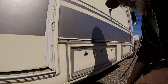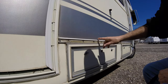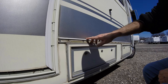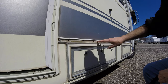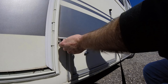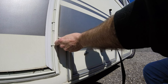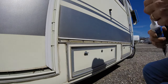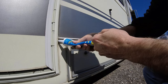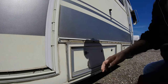The idea of this stuff is to cover these screw heads here that hold this rail on. But underneath this rail are screw heads that secure the flooring to the side of the camper. So this is floor level right here. There are screws that run through there, and then this covers it. The idea of this trim is to cover those up and create a water-resistant seal over all that. So first thing I want to do is stick a little caulk right here on this end for that to sit into and seal the end, and then we'll work out from there.